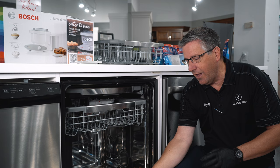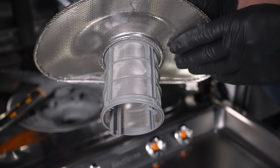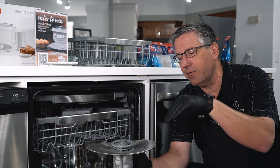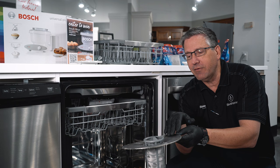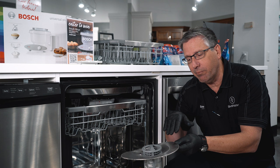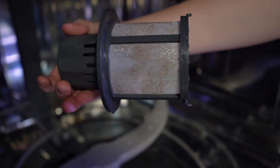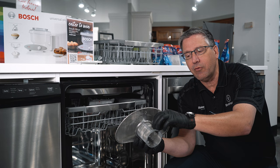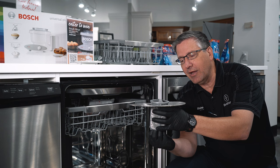When your food is on your dishes and it's being sprayed off, it comes down to your filter at the bottom of your dishwasher. You have two different filters — a coarser filter on top and a fine mesh filter underneath it. The water and food come down and hit the upper filter; the water is then pulled through and repressurized, sent back up to your wash arms to continue washing your dishes. The bottom wash arm has jets that push food down into the middle of the filter, trapping it inside.